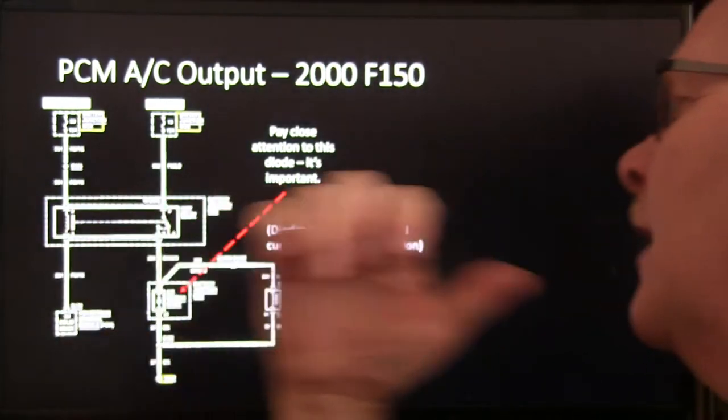You're going to look long and hard before you find an AC compressor clutch system in any vehicle of any make or model that doesn't have a diode in there. Relays have got little clamping resistors or diodes wired up parallel to the coil on those to keep those relays from spiking the engine controllers and other electronic boxes, because that spike is not friendly to those electronics. It finds places to go to destroy things.